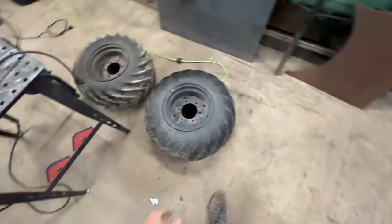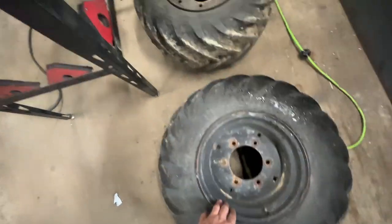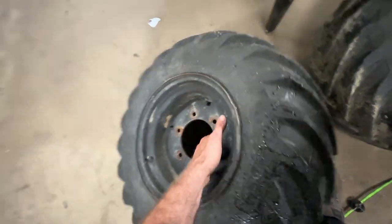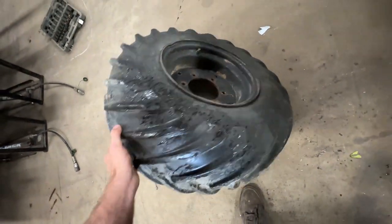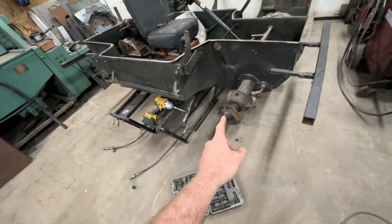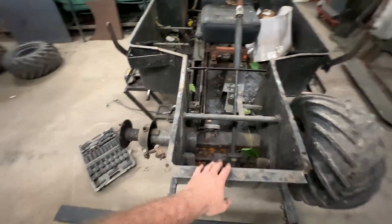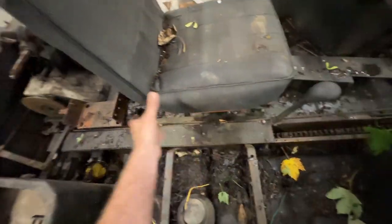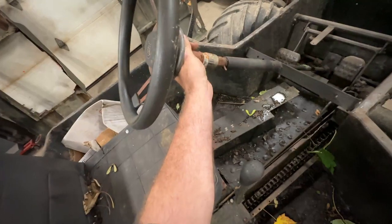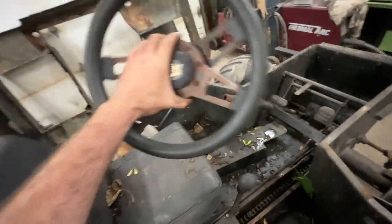The offset of our mounting flange or hub is actually the exact same front and rear, so you can use these wheels interchangeably, which keeps things simple. From this angle, our rear drive axle is actually narrower than our front drive axle, but the tub itself is shaped narrower up front than out back. I also noticed the previous owner modified a socket for a quick-release hub on the steering wheel.